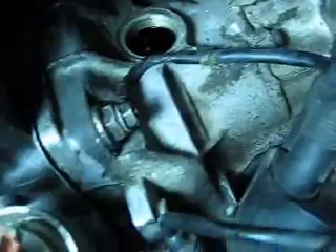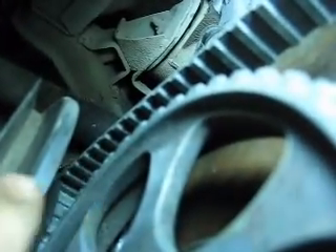Right, so now I'm going to put the belt on. I'm at top dead center here, this is pointing to cable number one of the spark plug, and the mark on the intermediary shaft is aligned with the mark on the pulley. The mark here is lined up here — I'm pretty disappointed I can't actually show you this clearly. If you have any questions you can just email me. And then you just feed the belt on.